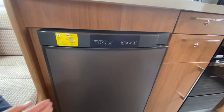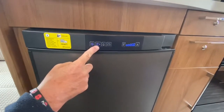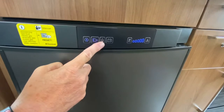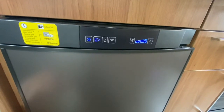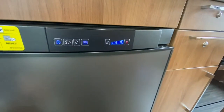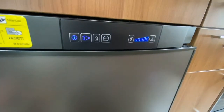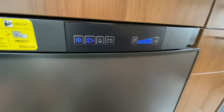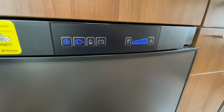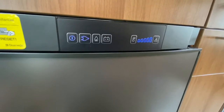To operate your Dometic fridge, turn it on and then select your source. You've got mains power — the plug icon indicates you are on main electric hookup at 230 volts. You've got gas — if you're wild camping, press gas and it self-ignites. Then you've got the battery setting, which keeps the fridge at the same temperature while the engine is running. What you do is hook the van up the night before, put your shopping in, and the following morning it should all be nicely chilled. Then put it on the battery setting and whether you drive half an hour or seven hours, your shopping will remain at the same temperature.